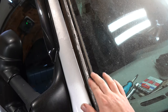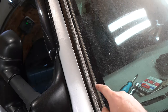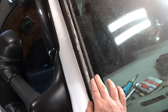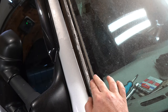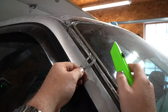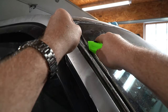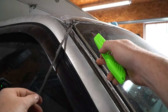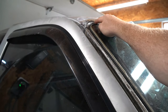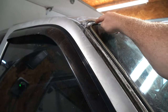There are a couple of different types of windshields. Some have a little gasket along the edge like this one did — you just take a pair of pliers and rip it off so you can access the gap between the windshield and the truck. To make the process easier, you want to remove whatever you can using a utility knife between the edge of the window and the frame of the car, being careful not to scratch the steel underneath. If you do scratch the channel, touch it up to prevent rust. I'm removing this windshield because there's bad rust in the corner that I can't properly fix with the windshield in place.